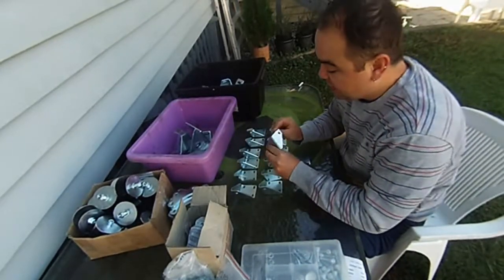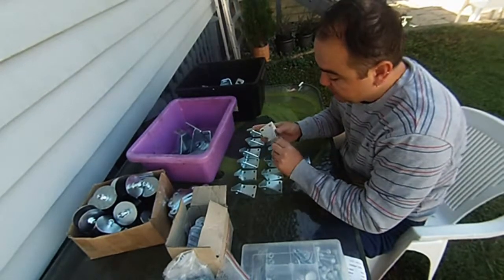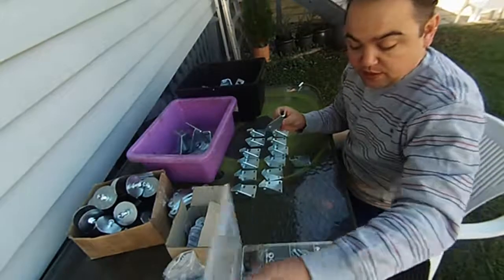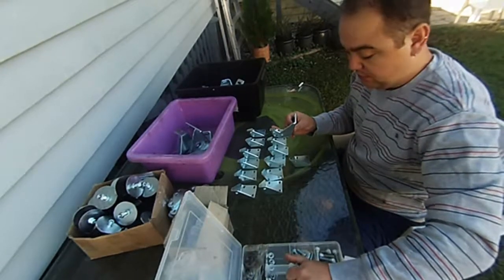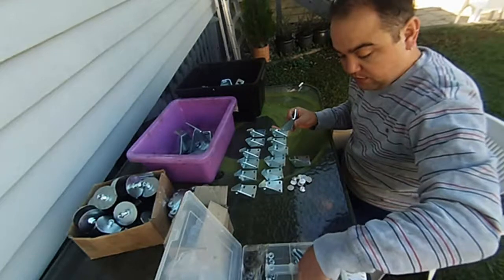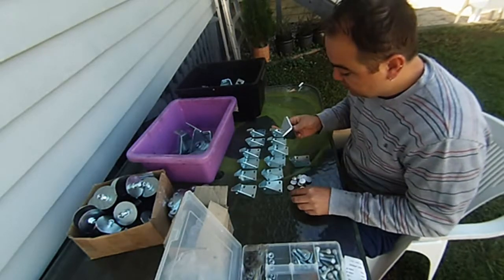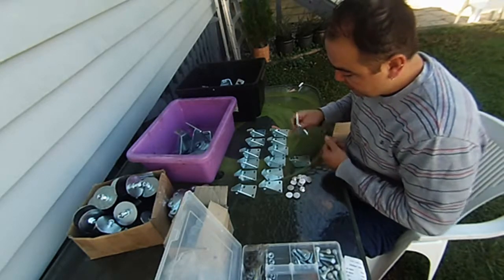This is my redesign of an R31 BMC stopper. Previously I had 3 plates welded together with a boss and a set screw that went in there with a jam nut and a cap. So I've still got some caps. They're all the caps I got machined up for the first batch. I think this is the 3rd batch, but due to time constraints I've redesigned it so it'd be much simpler to manufacture.